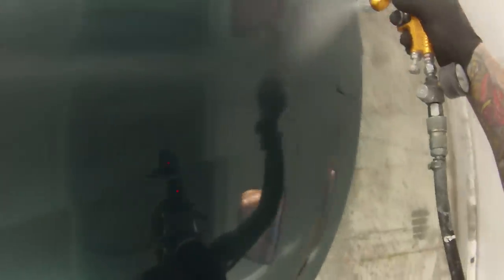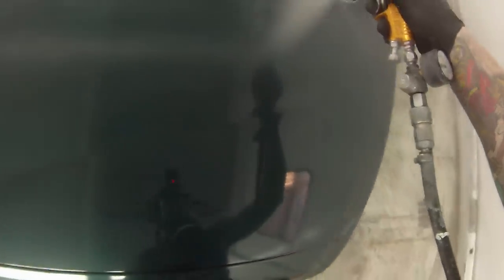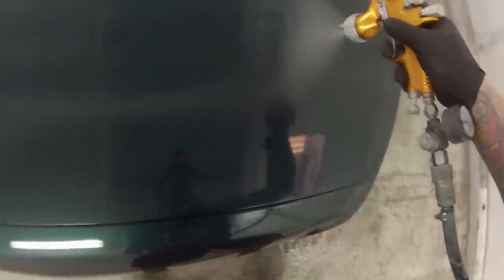It's made in Taiwan, whereas the GTI Prolite, which I may mention is actually the same gun as the Tecna Pro Light. There are one or two little differences: the Tecna Pros and Pro Lights are black, and if you see just above that regulator of mine, there's actually a little air valve on the bottom of the spray gun itself, and you can actually leave your regulator off and still change your air pressure with that little valve there.